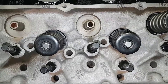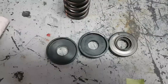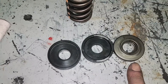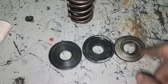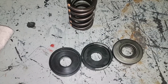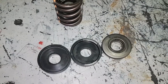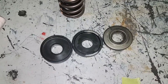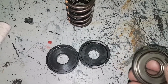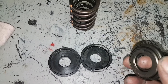We're working on these valve spring rotator eliminators — that's what we found was wrong when it came back from the machine shop. On the right here is a standard GM valve spring rotator, works kind of like a Torrington bearing. In a stock application they're supposed to help the seats cool and do all kinds of other things. They work fine, these engines can go a long ways, but they don't tolerate high seat pressures or high opening pressures. Once you get over about 220 pounds of spring force open, you're going to tear these up. There are basically three pieces to one of these valve rotators, and the more pieces you have in your valve train, the more things you're going to have in motion and the less you're going to be able to control.